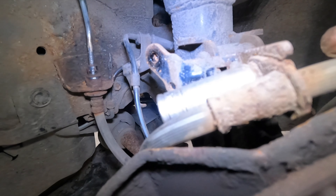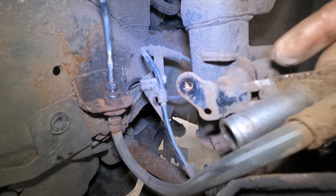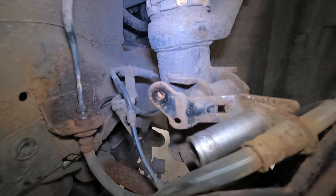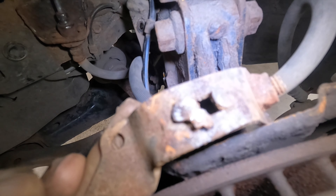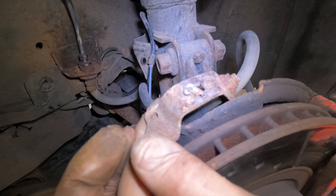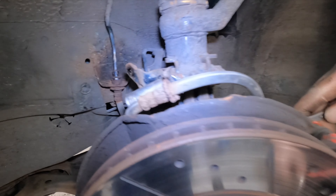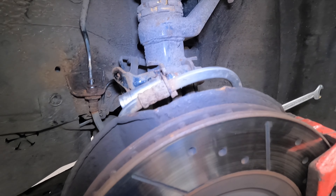These are about a year old. The actual bracket that holds the brake pipe and the ABS wires onto the shock absorber is snapped off. This is a brand new bracket - well, just over a year old - and it's already rusted and snapped off. So the welds on it are pretty poor. I'm quite surprised at that. This is fitting Yellow Speed brakes which we have high hopes for, and we're struggling to remove a bracket off a Yellow Speed component that's just over a year old.